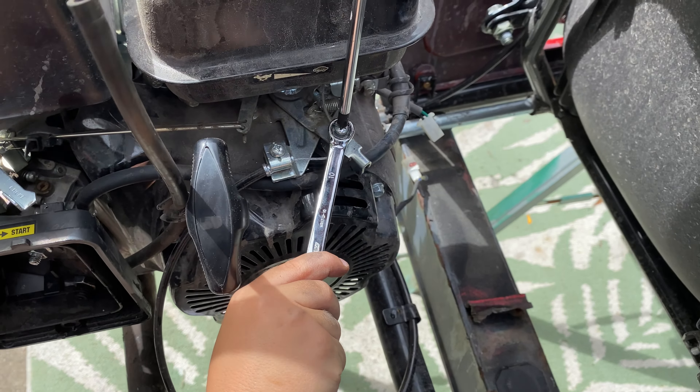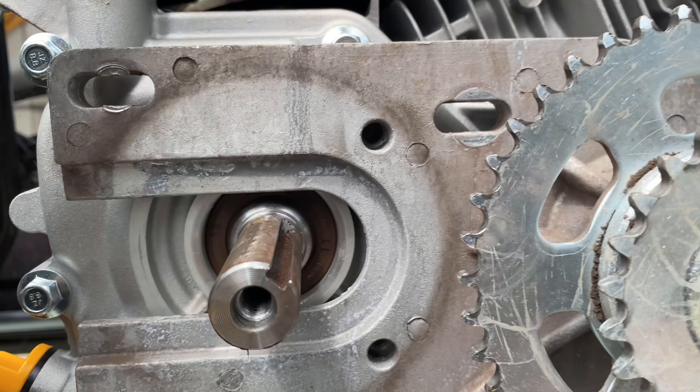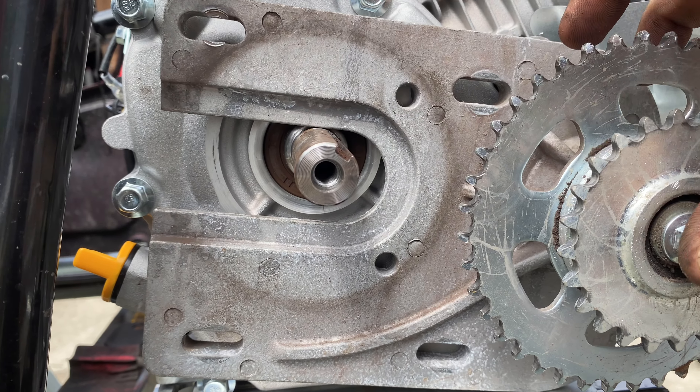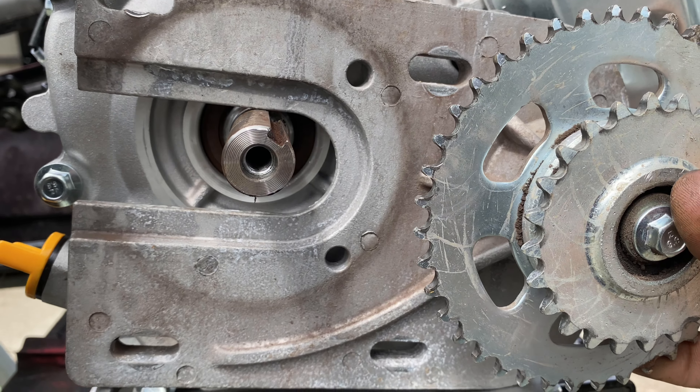The jackshaft is what comes with all the little Coleman carts with the 98cc engines. You can get a bolt to line up there, and that bolt lines up there — you can kind of see the mounting hole there that lines up. There's a fifth one up and behind that you can drill a hole for, and two more up here you can drill holes through this plate. You'll have to pull these gears and shim them out with some washers because of how the three-quarter-inch shaft clutches fit — the gear sticks out a little further, so you've got to space it out to get everything to line up.